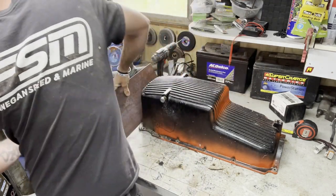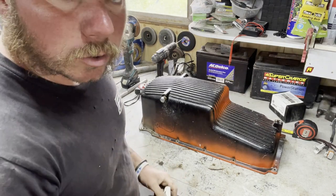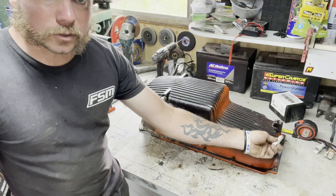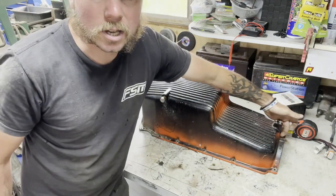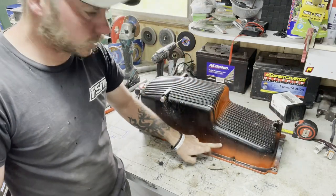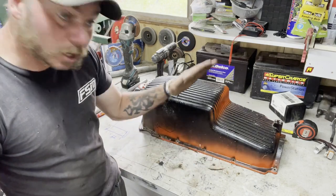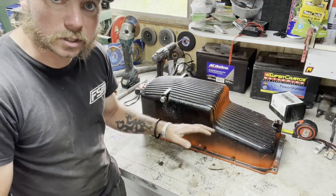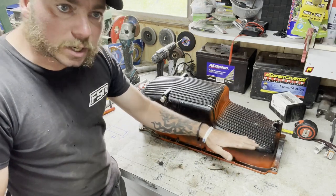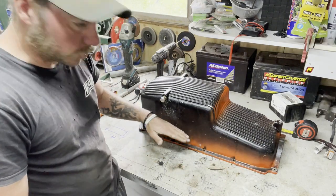Now what I'll do is score a line up there, then mark it off the top where the seals are - probably come down about 5 to 10 mil - and mark a line all the way around the edge. I'll cut that off and that will tell us where we need to be on this. That'll give us the bottom piece, and then I can put a chamfered plate on here so it'll come down on an angle at the back to the 320 mark.